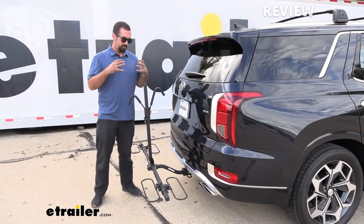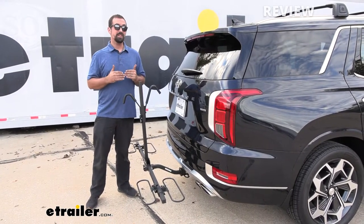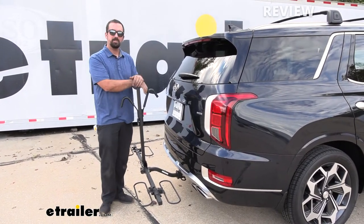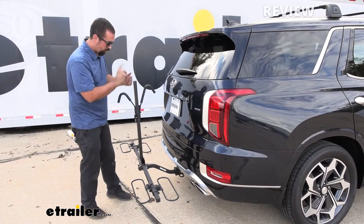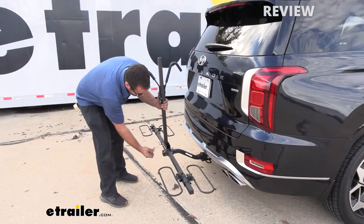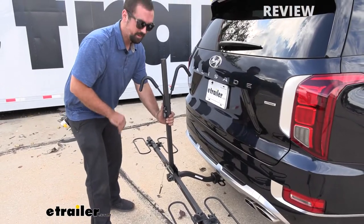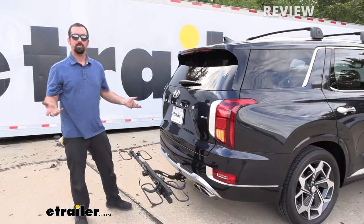Platform style is my preferred bike rack method. Something else I generally look for is a tilt style, and that really does come at a more premium price to get a platform tilting. What that is beneficial for is if I need access to my hatch, I can still access it, but I do have to take my bikes off. To do that, it's very simple. This pin down here, you can pull that off — it is attached to a cable too, so if you have fumbled fingers and you drop it, it's still going to stay in place. This does tilt down and then you can get to your hatch, no problem.